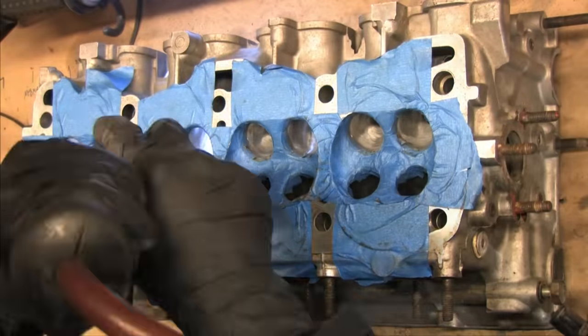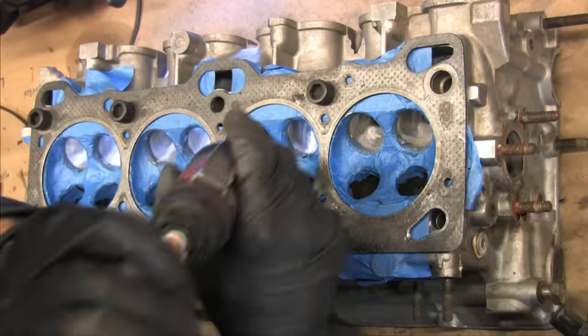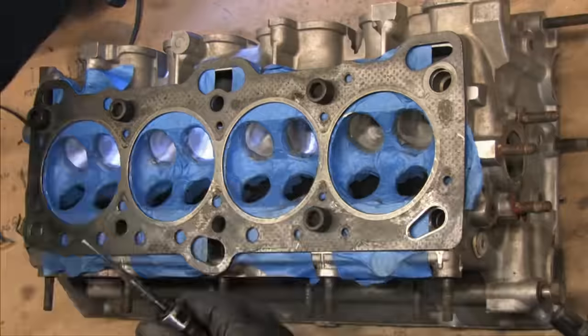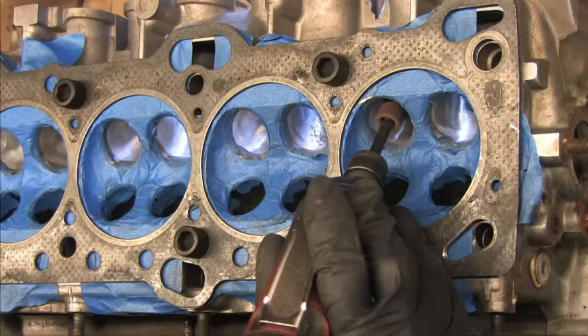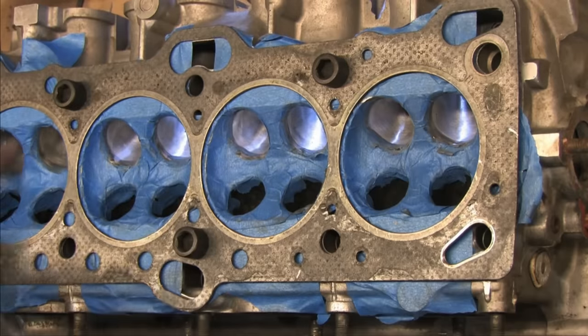I don't use carbides on the intake side because I find them to be far too aggressive, and because 1G intake ports don't really need that kind of treatment. Doing your contour work with sanding rolls tends to produce smoother end results. It just takes a bit longer. I think those results versus screwing up are well worth your time.